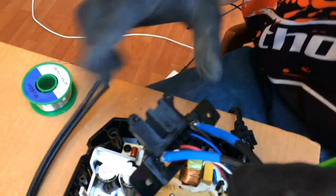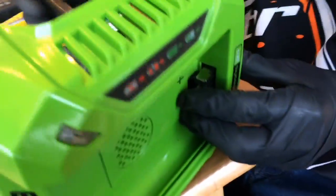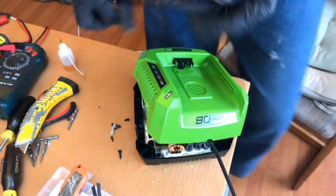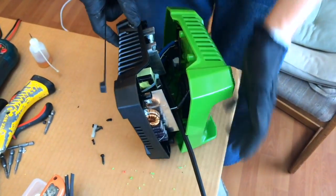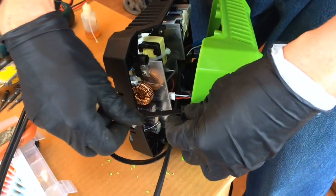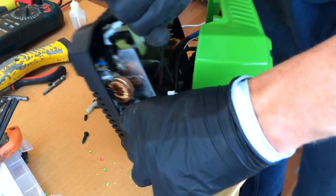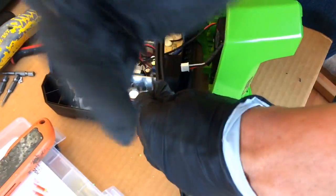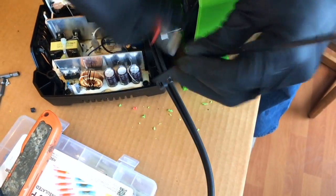We managed to cut the plastic so you can see the wires sticking through, and now we're just going to mount it right back in the hole. Now what we're going to do is put it back together, and we want to do a strain relief on the cable so that when it yanks, it doesn't come out. We figure out just a little bit of slack inside the cable, then put a zip tie on it. What I do is put a zip tie on pretty tight and then wrap it in duct tape — the combination of the zip tie and duct tape basically doesn't move.